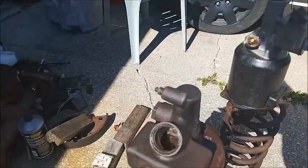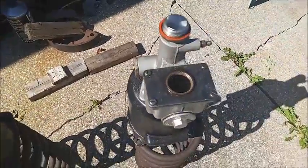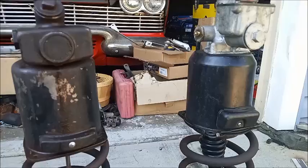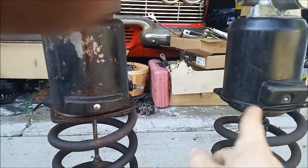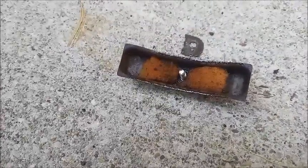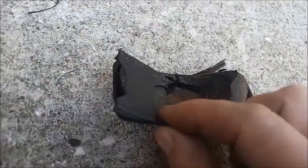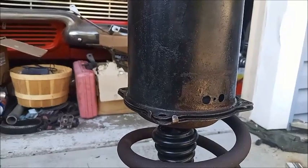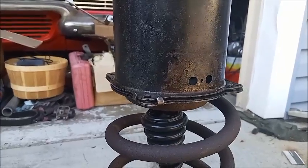I was recently testing both units, so they both have clean brake fluid, but we're going to be disassembling them, so it's going to go away. You can see down in there. First thing I'm going to do is remove the two air cleaners. The Delco Moraine has very ratty old sponge, whereas the Bendix sponge is in pretty good shape. It's got this rubber gasket too. Once you get the tabs pried, the Bendix is easier to take apart, and we'll see why.